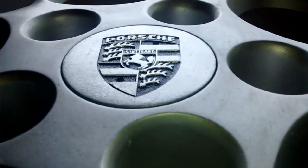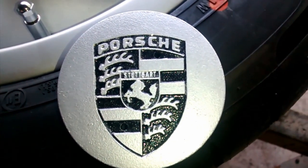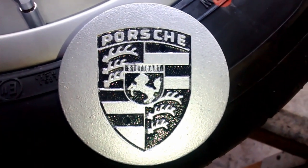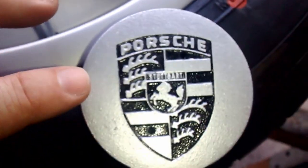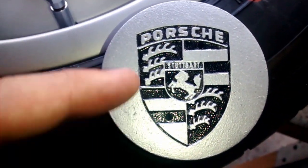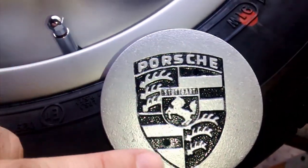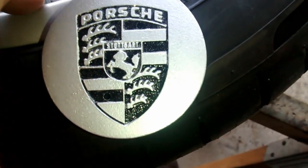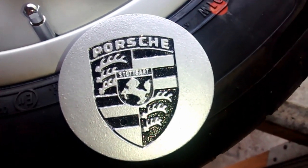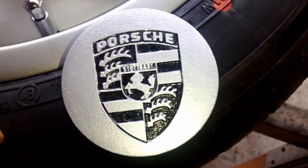How I painted my center caps. What you do is clean them off really good, get any old paint and scratches off by sanding and brushing. And then once it's all set to go, I like Tremclad gloss black. Just spray that in there and make sure you fill in all the recesses. And once that's cured, set and dried, you've got to leave it a good 12 hours, I'm thinking, until it gets nice and hard.